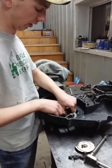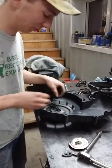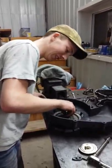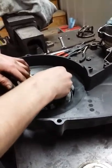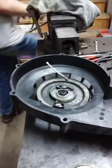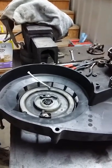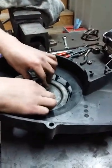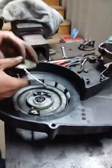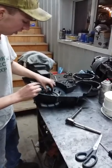Now you bring this here and you have to go back three times. But before we do that, we put this on here so this won't fly apart — that's one of the steps I always forget to do. Now make sure you get that all in there the right way. Just got to slide that around there and that spins really nice. Sometimes it's good to get a little bit of dry graphite lube and just spray a little bit on that pin. That makes it spin a lot better and your recoil will never skip on you after you do that. There's a little mechanism on here and that's what puts on that pawl and keeps this moving.